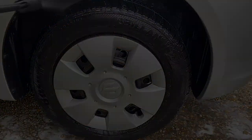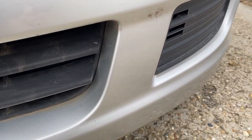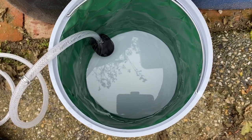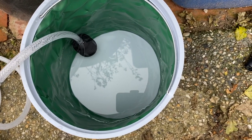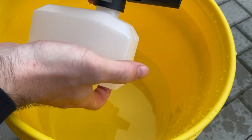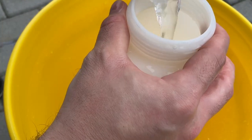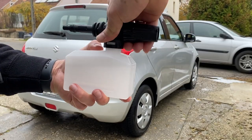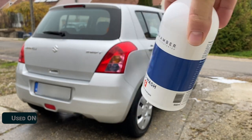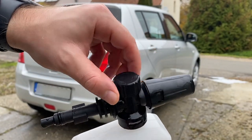The bodywork is in a much cleaner condition — only the plastic and rubber parts will need some extra care. I usually start with a rinse on the bodywork as well, but with a portable pressure washer I skip that step to use less water. The foam in the cannon will help soften up the dirt on the paintwork. A few things about the soap cannon itself: my measurements show the bottle capacity is approximately 400 milliliters, the cap goes on very easily, and there are two features I haven't seen from any other brand in this category — the changeable direction on the nozzle, and the ability to change the volume of mixture on the top.